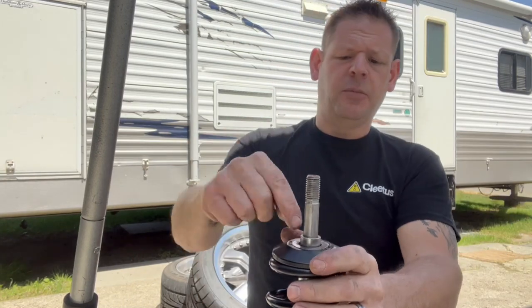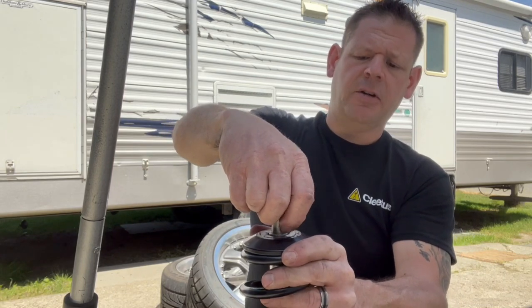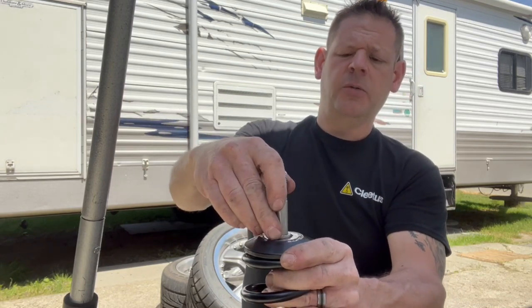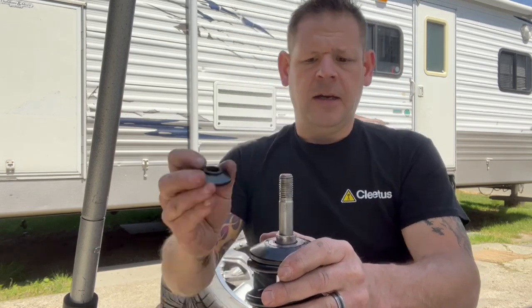So the next step is to put this bushing in here, or find the appropriate bushing in this place, so I can move the spring up into it, which will eliminate the play it has. But then I still have to get the cap back on and make sure that I have enough space that I'm not touching my camber caster plates underneath. So I'm going to play with these bushings, and then we'll get on to the bump steer kit.